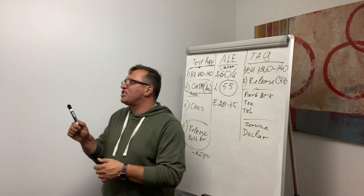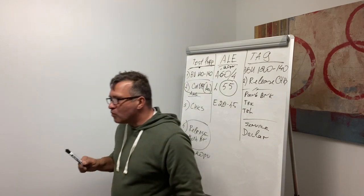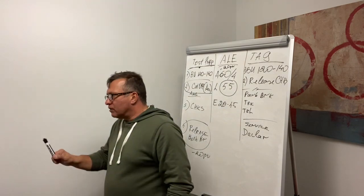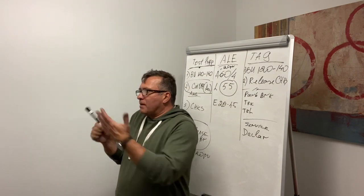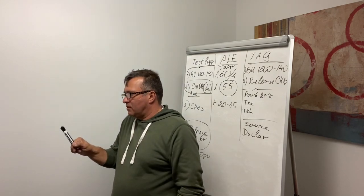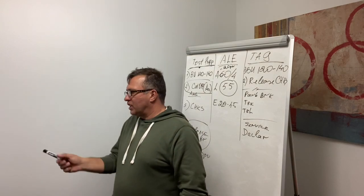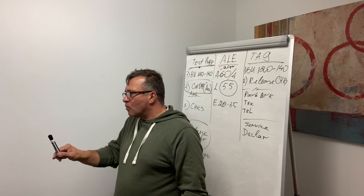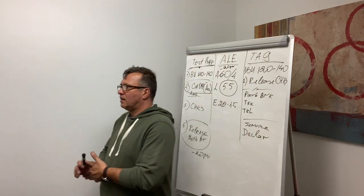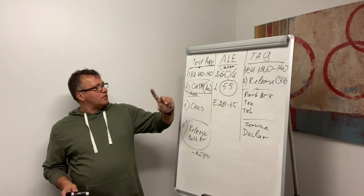So I was checking how much pressure my system loses after I pushed the brake pedal and the air stabilized. When you push and the air stabilized, by instruction, by the point of common sense, that's when you're checking how much. Okay, you pushed it, it's stabilized, and then you shouldn't lose more than 4 PSI. If you lose more than that, there is damage, there is a leak. Okay? Very important moment.